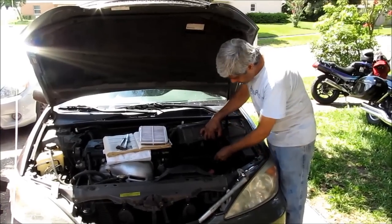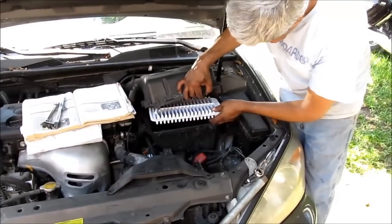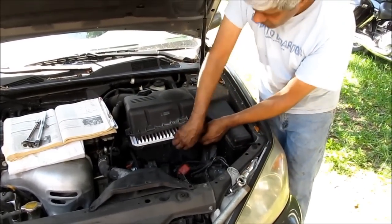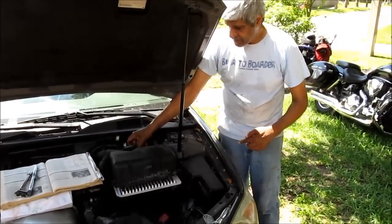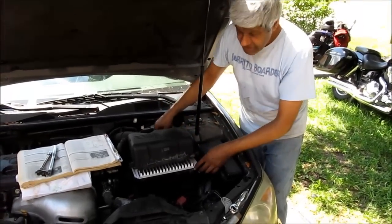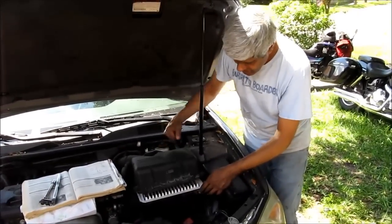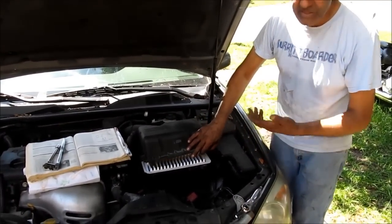Okay, I've got those 3 bolts tightened. Now it's time for us to get our air cleaner filter back inside. And also a reminder, before I removed this bottom housing, there were cables attached to the housing, just like a tie wrap, that had to be taken off before I could remove this. Otherwise the sensor cables behind are holding onto this from the back, so I just had to pull it out and disconnect it, and the rest we'll get back when we start the car.